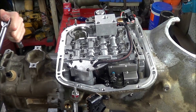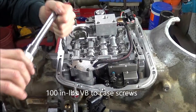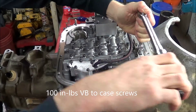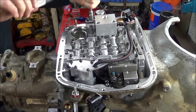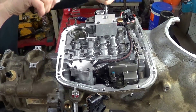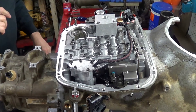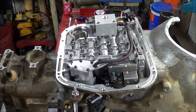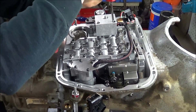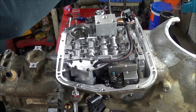The valve body bolts are all 100 inch-pounds or 12 newton-meters. The best thing to do when torquing these is torque them once - if you start going around and cranking the torque up you're going to have a problem. I like to run these in first with my T-handle. Tighten these up and pan-tight is good.